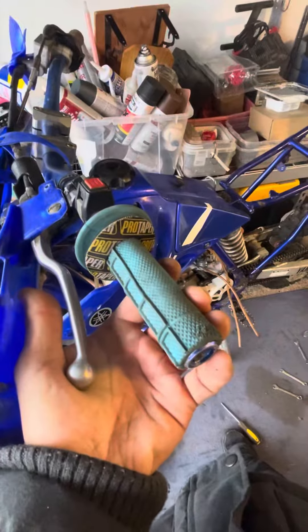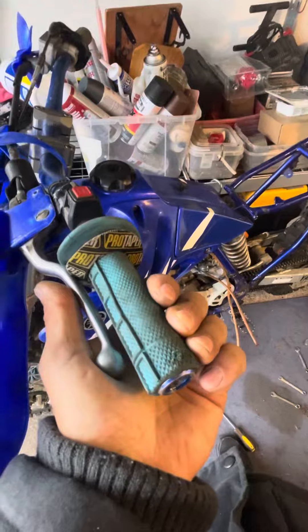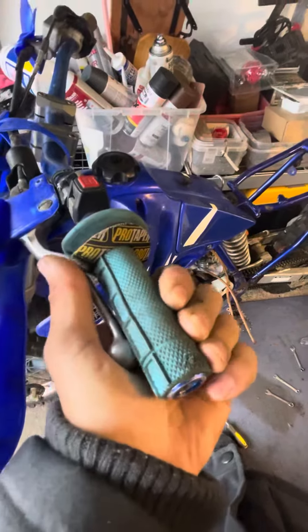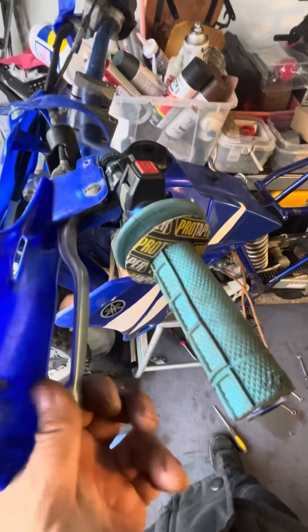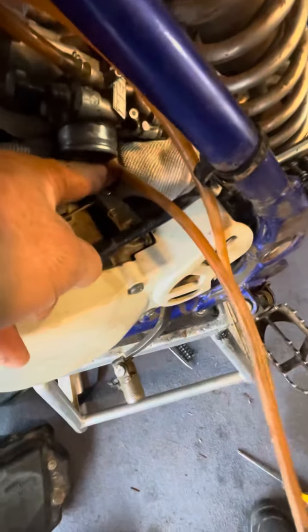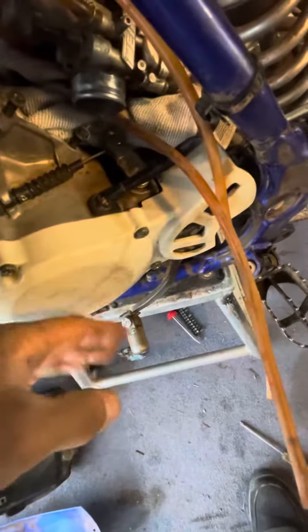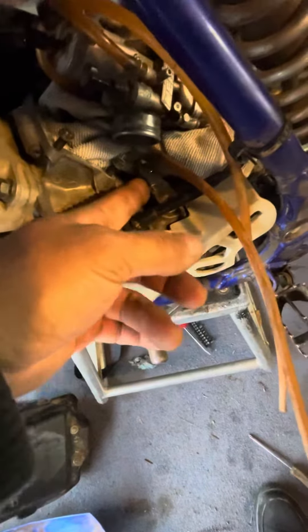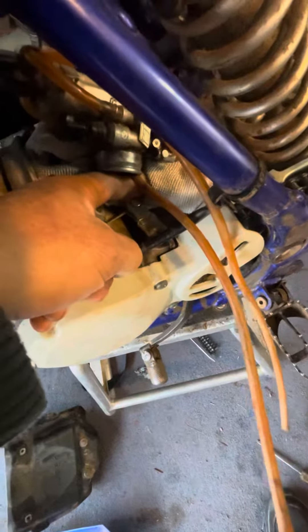So now when you go, you'll have your clutch action right here and start to grab. And then now you should be able to shift it in gear. And when you release it, it should start to grab somewhere in the middle like it's supposed to, not right off the bar. And then when you let it out, this should be completely loose and should have wiggle room in it. That means inside here, the clutch is completely grabbing and bitten down 100%. So when you apply full throttle, it'll grab, and you have zero pressure on the clutch plates which would be disengaging them. And the cable has no pressure on the perch. And that's how to properly adjust your clutch.